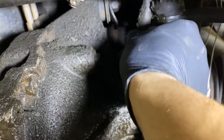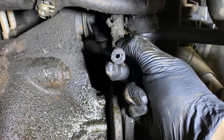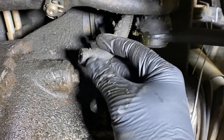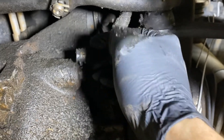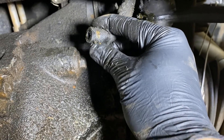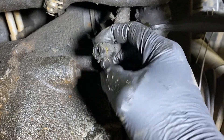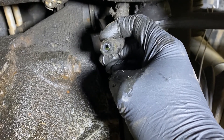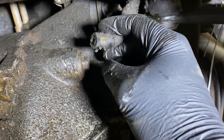Taking a closer look at the vent hose, I actually broke the fitting that goes into the differential when I pulled it off — you can see a piece of plastic in there. There was so much grease and grime I didn't notice there was actually a clamp here. So be careful — don't do what I did. Loosen that clamp, slide up the hose, and then pull your vent tube off. I'll have to buy a new vent fitting that screws into the differential. We'll link the part number in the description just in case you have the same problem.